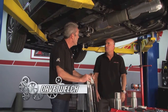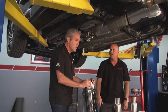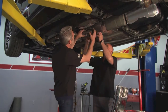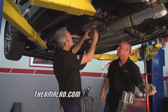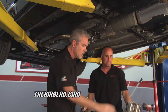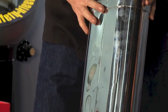What's going on first? Well, we have left the OEM front connections, and now we've put our two and a half to three inch adapters in. So we've got our adapters here, and they're just going to slide in our original. Probably grab a clamp, and the clamps are stainless steel too, right? Yes, sir. Okay, now this guy goes on? Yes, that's the center resonator. It has a sound absorbing and a mixing chamber in it.